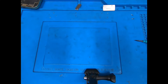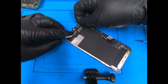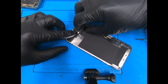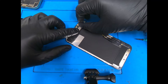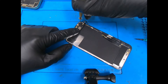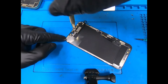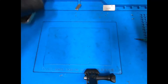I'm going to go ahead and put the old screen aside and grab our new screen. We'll put our ear speaker back onto the new screen — just like that — and make sure the proximity sensor goes into place, just like that. We're going to go ahead and start with our Phillips screws: top right, bottom right, then our tri-points: bottom left and then top left with the tiny one. There you have it, screen's prepped — let's bring the housing back.